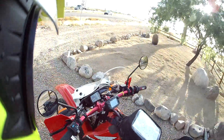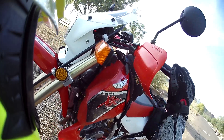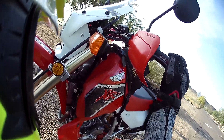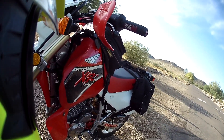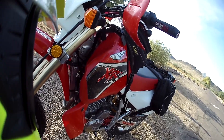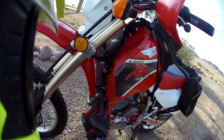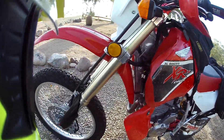Anyway, that's where we're sitting now. I'm just going to take it for a test drive. I had the tank off to wrap this wire and stuff like that. I checked the plug and the plug was perfect — I mean, literally perfect. So jetting's all done.